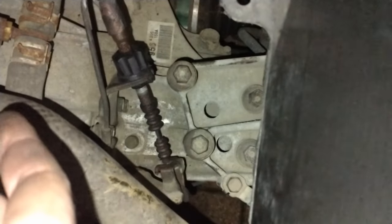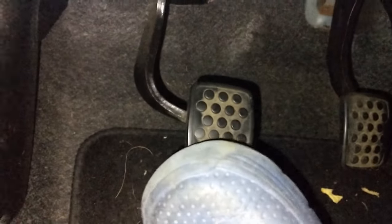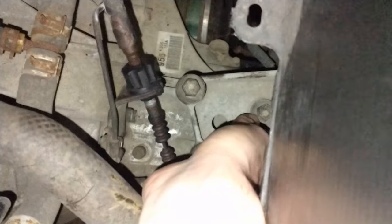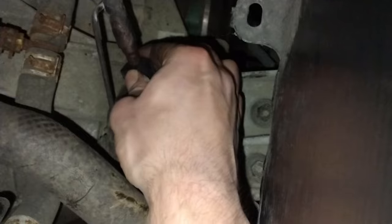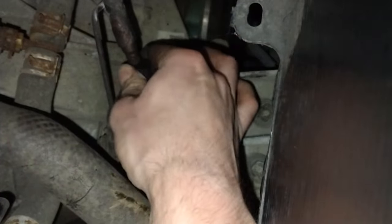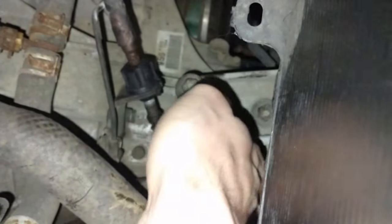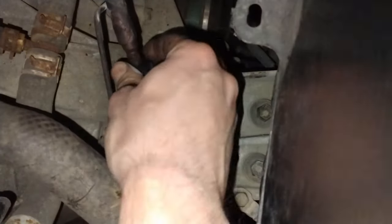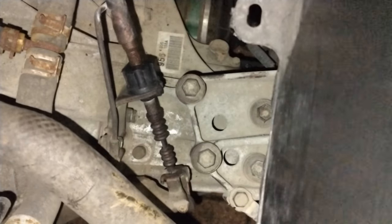The pedal feels more or less the same. If you feel like you're jumping back and forwards, what you can do is actually move the clutch arm itself and have a look at all the free play you've got by the actual mechanism. We've got quite a lot of play here, which is causing all that extra play on the pedal. So if we make our adjustments down here — going clockwise — and then check again: a little less play. Turn it clockwise a little bit more, feel more resistance. Adjusting that a little bit more — that feels very nice.